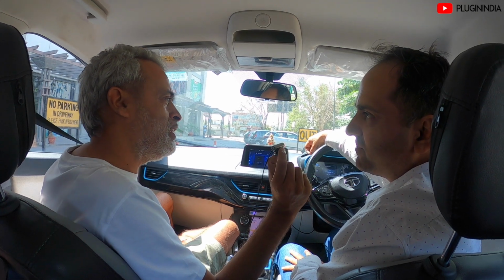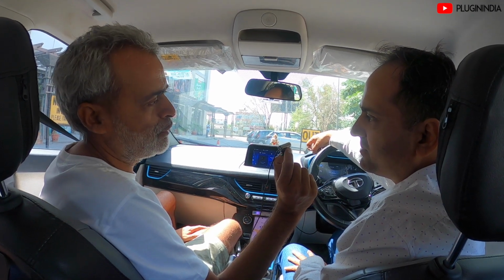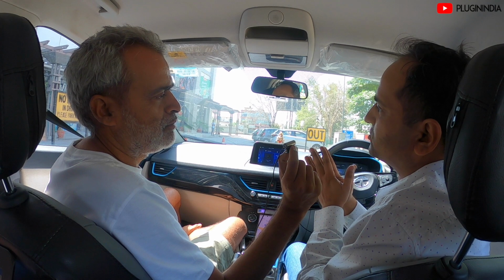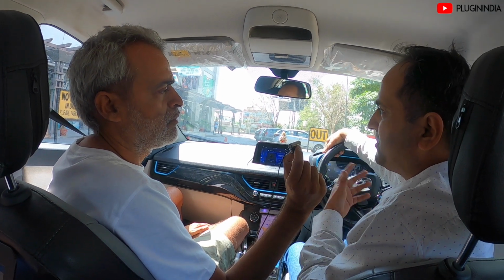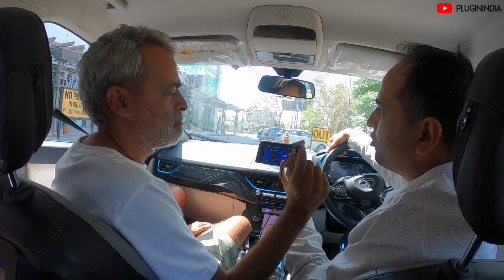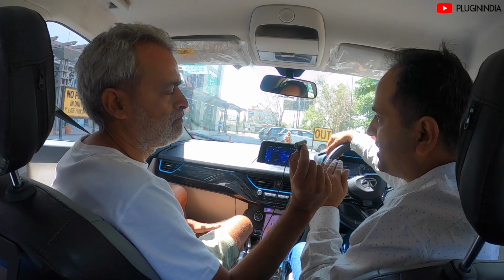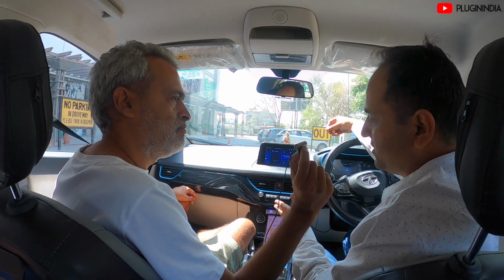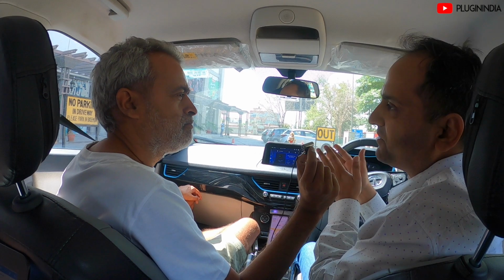Correct. So what's keeping 3D printing from getting into production outside of R&D? What's the main constraint or bottleneck according to you? I would say it's the technology itself. The USP of 3D printing that's been sold to customers is that you can customize everything, or do mass customization, which in my opinion isn't really correct. It doesn't really happen because it takes a long time. For example, if I make something out of a mold, I can make 1,000 pieces per day, and a 3D printer can never match that. On top of that, customers are used to really good quality output, for example, the glossy finish of this, and a 3D printer cannot deliver that. So it's good at what it does, but the technology is not there for the end customer as yet.